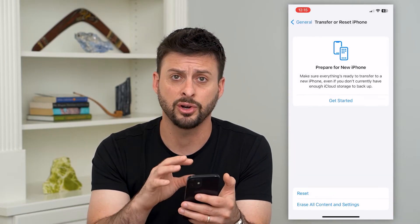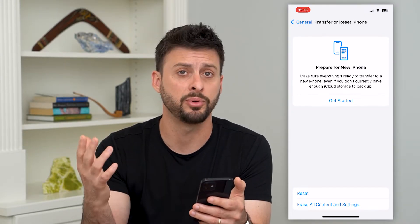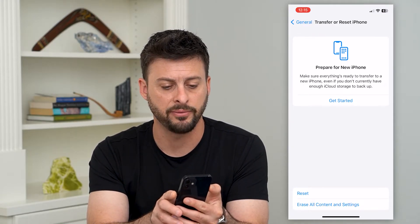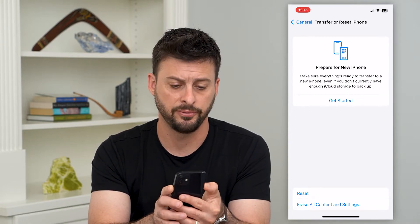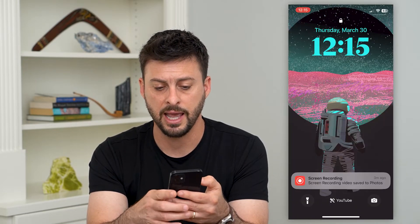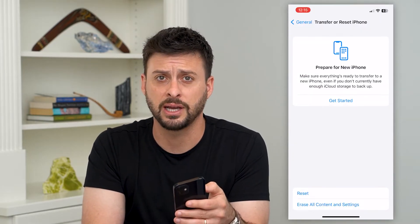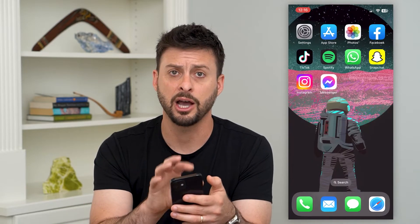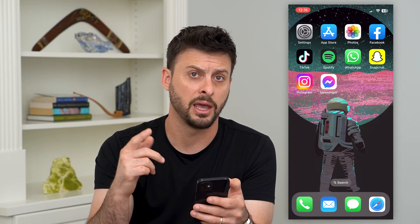If it's turned on and you want to force shut it down to help reboot it, one option is the force shutdown. Tap volume up, volume down, then tap and hold the power button. If you keep holding and don't swipe to shut down, it will force shut down your phone and stop all running processes. This sometimes helps if there's a bug or glitch causing this infinite loop of shutting down and restarting.